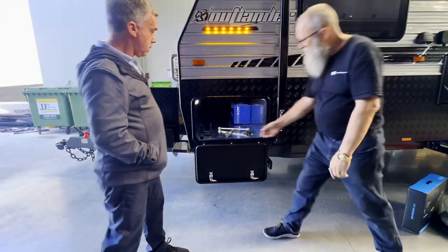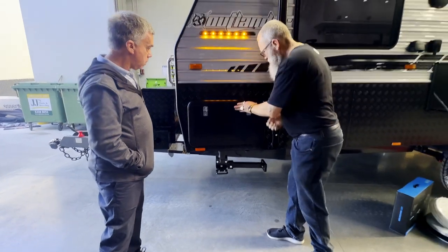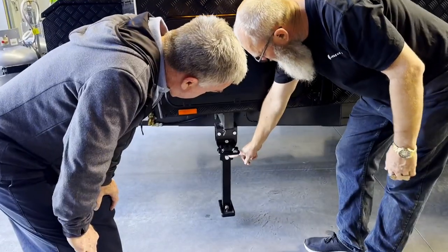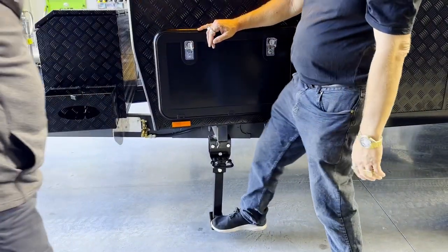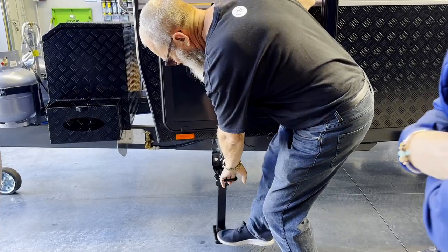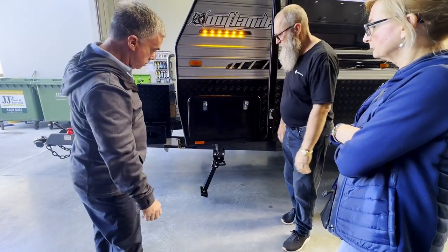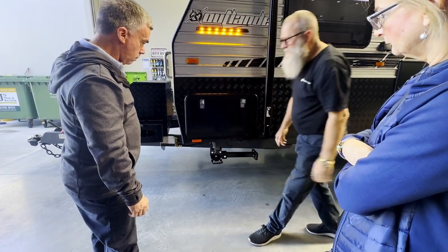Careful, jack leg wind up. That one is so you can wind your support legs up and down. So grab the leg, pull that lever, lower them down. Then that winder goes onto there, wind those legs down. Now you'll notice that they still move when the van's on it. You're actually better off popping it out there, because when it goes down it's nice and secure and firm. You're not going to get any movement in the van at all; you're a lot more stable. Make sure that one's gone back in, otherwise it can fall back down on you.